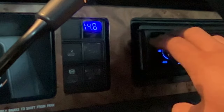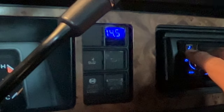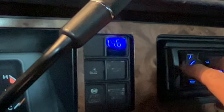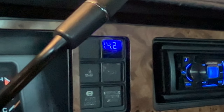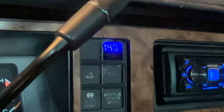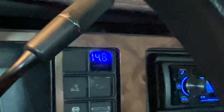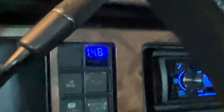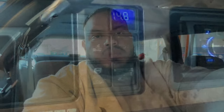Now let me turn the music up so you can see in real time what a volt meter does for you. And that's what you want to see — you want to see your voltage up there. You definitely don't want it to get into the 12s or below. Maybe 12s are okay, but definitely not in the 9s, 10s, or even low 11s, because then you might run into clipping. Clipping means you're starving your amp of power, and it's not good for anybody.